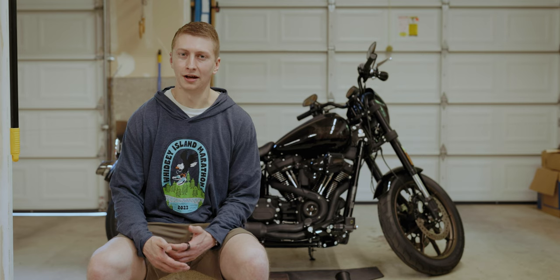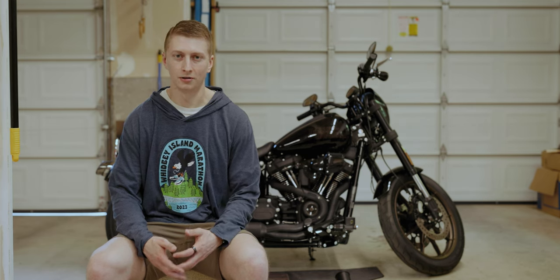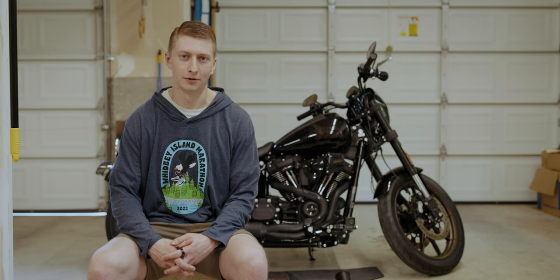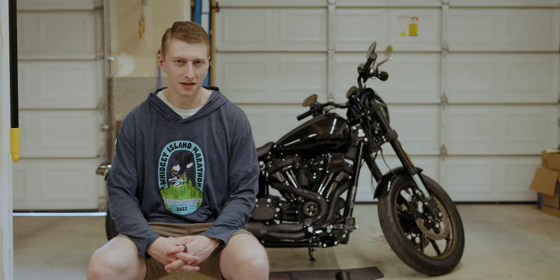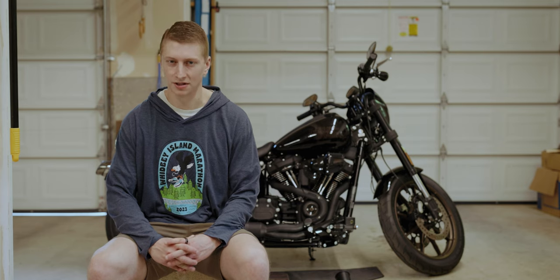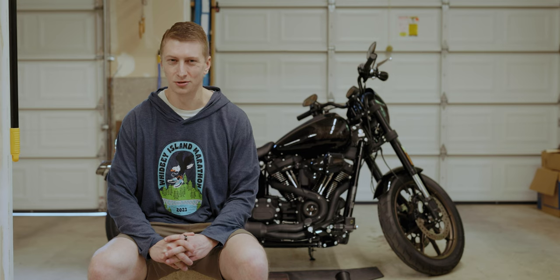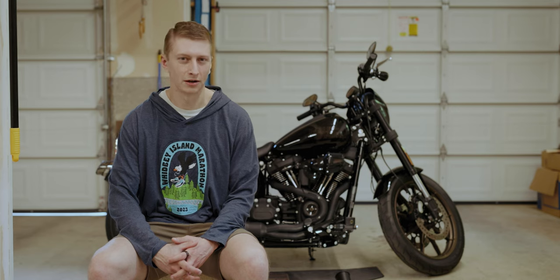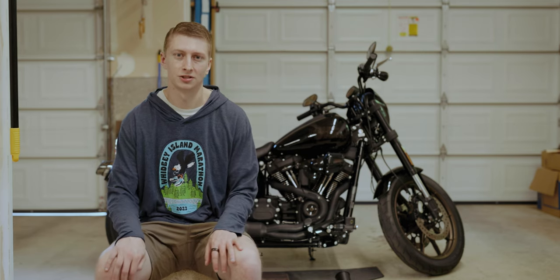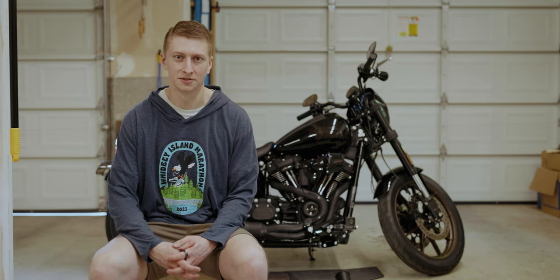So again, kind of funny in hindsight, to see how many of the problems we ran into were self-induced and just part of the learning curve, or being unprepared with the right tools on hand, right? It's a classic problem. The only thing I will say is I do wish the Vance and Hines instructions that come with the system could be a little more clear about a couple of those things. Mostly speaking to the flange for the exhaust header not necessarily needing to be flush. That one seems a little counterintuitive, but again, this is my first time wrenching on a Harley, so maybe that's just a common knowledge piece that I haven't picked up until now.